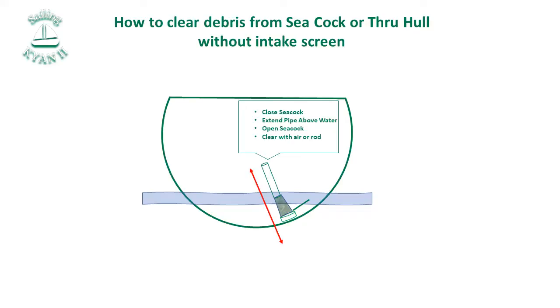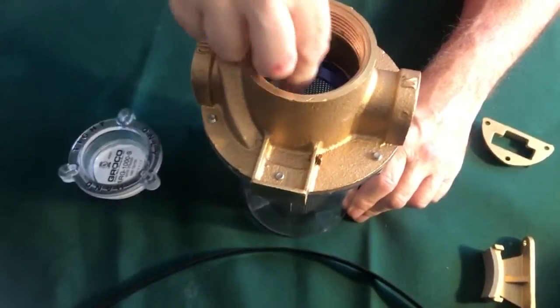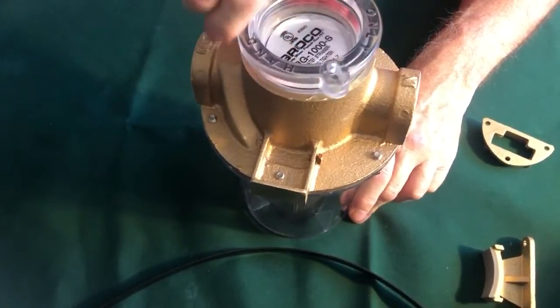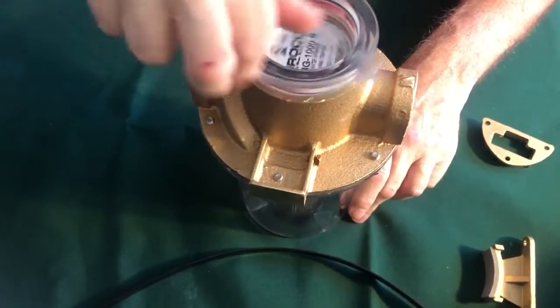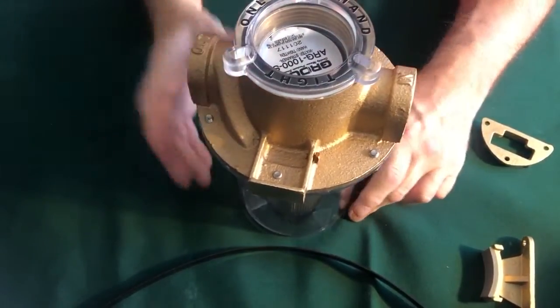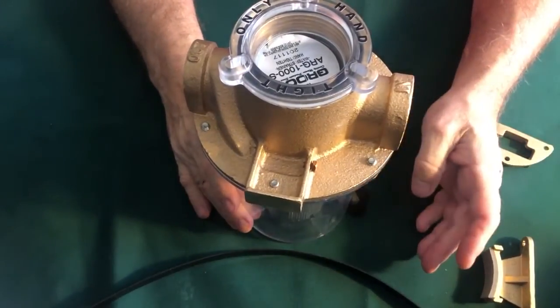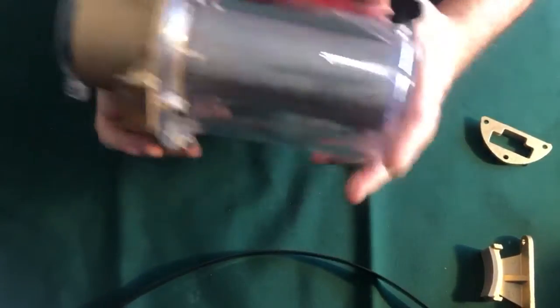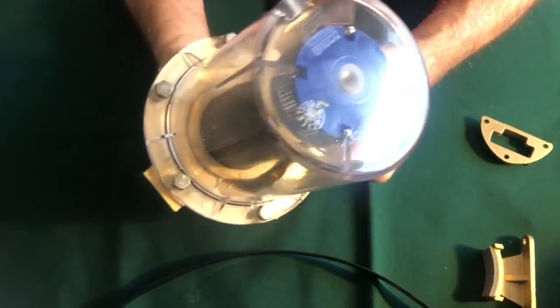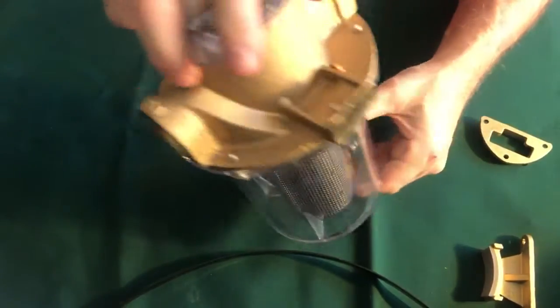You should do this at least once every time you change the oil — check the sea strainer. If you're in places that are difficult to work with, such as some places in Florida where you have a lot of algae buildup, you need to check this every 10 to 15 hours to be safe. The bottom of the strainer cup is bolted on at 25 foot-pounds pressure for each bolt. It normally doesn't need to be taken apart — this is a very tough piece of material.